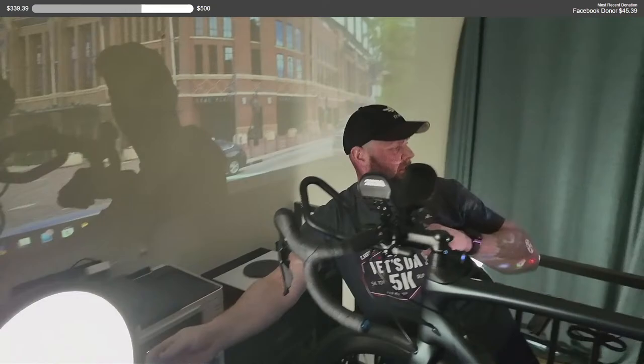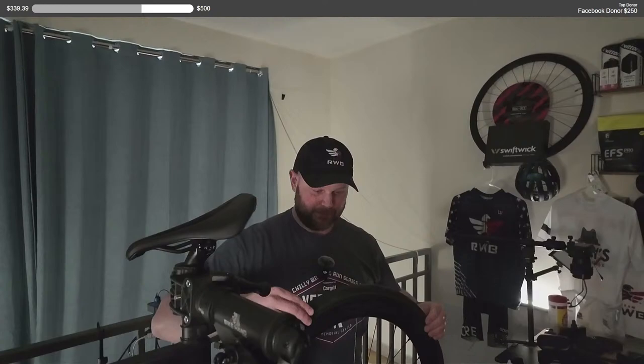So, on last week's episode, I kind of opted not to, on camera, put tubeless tires on. I have since done that. I also used Silca's tire PSI calculator for tubeless. It says, hey, you weigh too much for us, your tires are too wide, but here's a number. It should work. 67 PSI in the back, and I think it was like 66 and a half up front. So I'm just going to run them even.